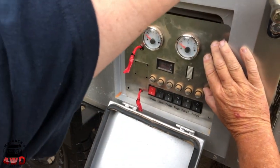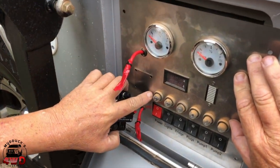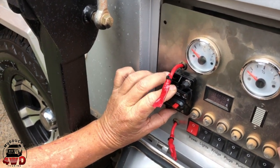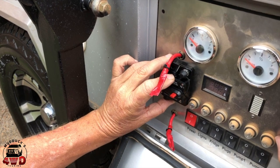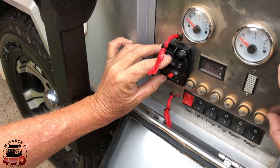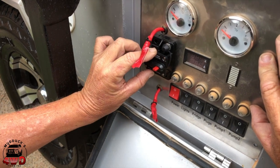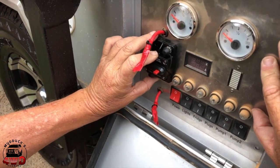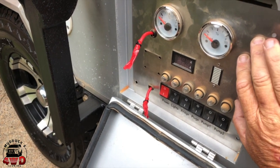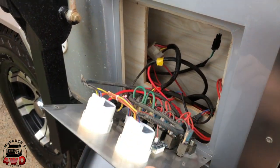Well, I've got that old circuit breaker off. Here's the new one. Yeah, I've got to drill out this hole a bit bigger. I could reutilize that hole. And I'll put a new hole up there in line with that, and that'll hold that roughly in place. And I'll just be able to hook these two existing wires up to that. And that should be a far better breaker if it does the job. So I'll just drill out those and get that on. All those other holes won't make any difference because it's in a supposedly dustproof cabinet. Dustproof, that is. Ha ha. Chinese trailers.